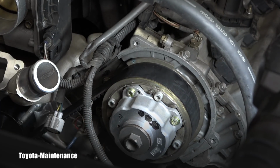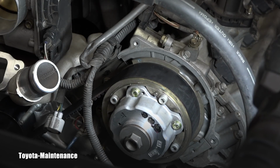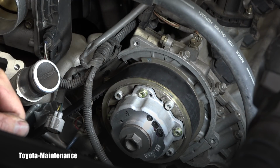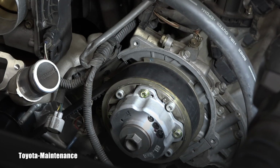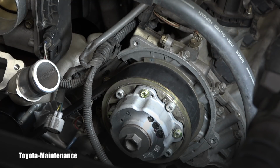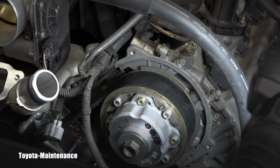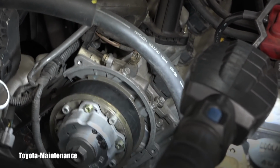I did a good job, right? And everything's fine. And here they are coming slowly. The moment of truth, right? I want to see them in exactly the same spot like before. And believe it or not, I have 0 on the harmonic balancer, and both camshafts are in exactly the same position. Let me show you without stopping the video, right, that it's perfect, and I'm ready to go. This is successful.